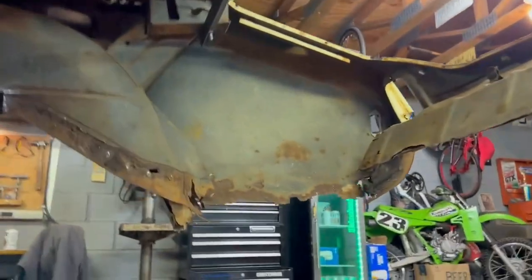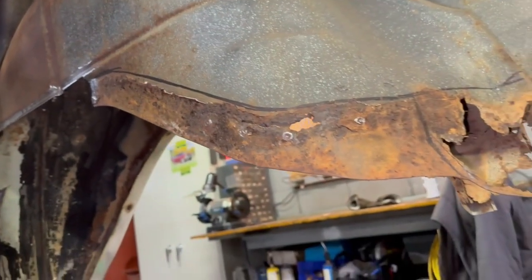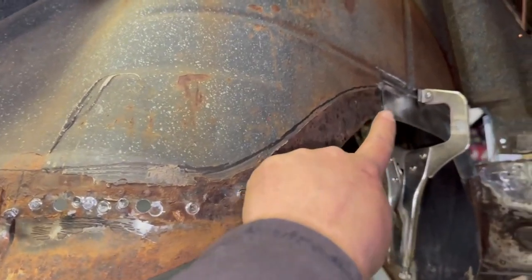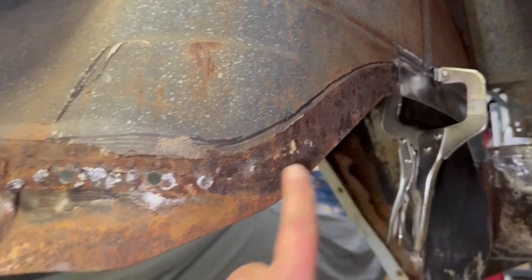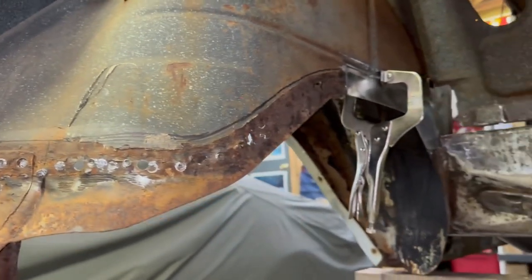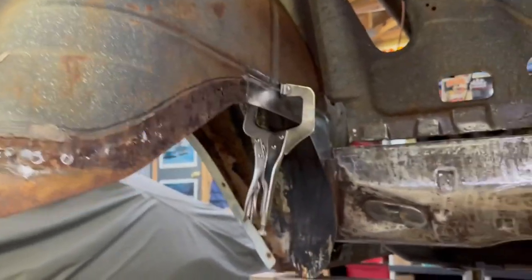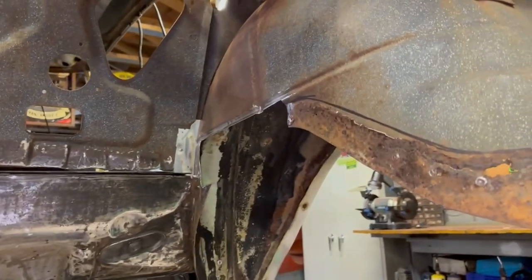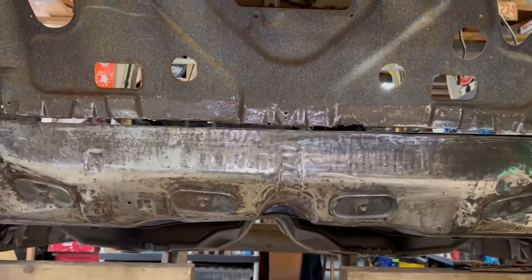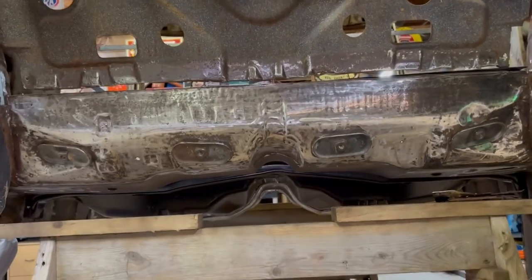From the other side you can see the rear portions of the inner wheel houses. I intend to make a piece from there all the way down to here — one piece. So I'll have one, two, and then we'll get into that third piece. The plan is to get all of this stuff together so we can get this car back into a solid structure underneath and get the new trunk floor in the car to match all this.